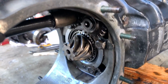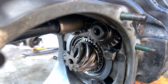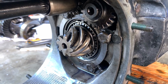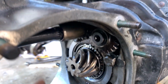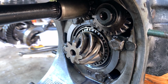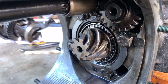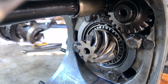So I'm actually stuck here. I'm releasing these four bolts, and it looks like there are a couple of versions of the Volkswagen transmission. Mine has the four bolts, and others have some kind of big sleeve, and to release that you need a special tool. I watched so many YouTube videos, and someone is taking apart this four-bolt version, but he didn't seem to have trouble releasing it.